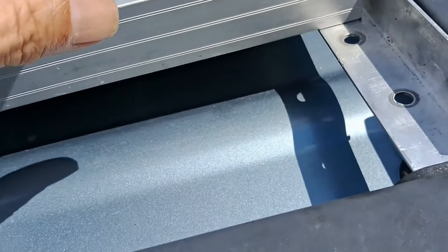Ever since I mounted my in-house battery up there, there's been a lot of weight, and whenever I stop the vehicle hard, the bed tends to move forward. So what I did is I put two eyebolt hooks in — one on each side.